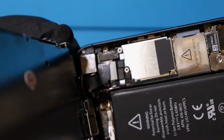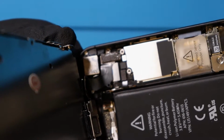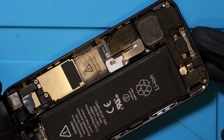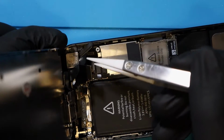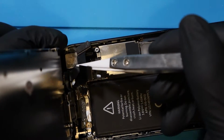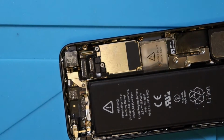There's three ribbon cables that you can see just about there that I need to take off now, so we're going to do that really quick. A lot of people have advised me, and I haven't ignored them, I've forgotten, to be honest, that you should be removing the battery first. There it goes, and then you've got the final one at the back, which is the biggest one, and then you can safely remove the screen.